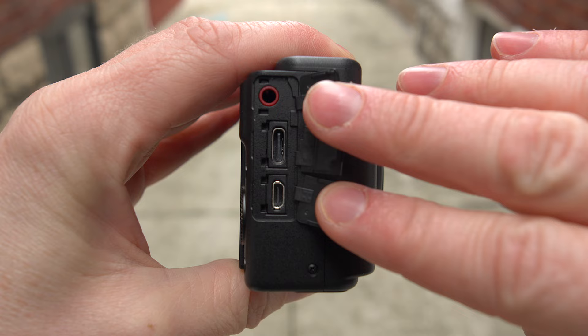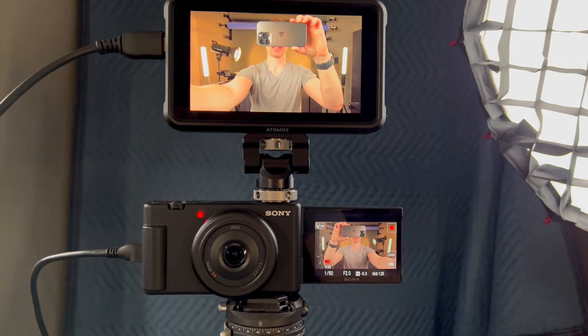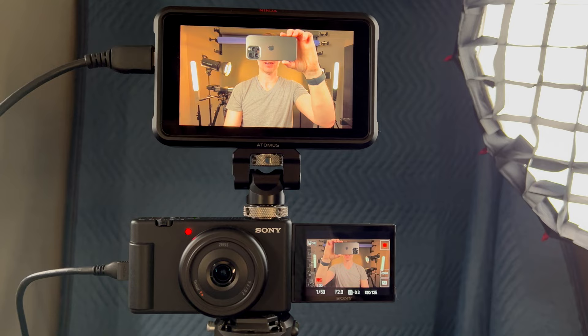The USB-C port can also be a direct webcam or streaming port because you don't actually need any software or drivers — it's just plug and play and will go directly to a streaming service or directly as your webcam. It will output in 720p though. So if you want a higher resolution than that, you use the HDMI port — then you can stream at a much higher resolution. You can also use the HDMI port for monitoring your video. Right now I have connected my Ninja V monitor and the cords are on the other side, so I still see my full flip screen. Check that out — full flip screen and the Ninja V monitor. It's the little things sometimes.